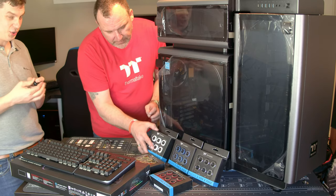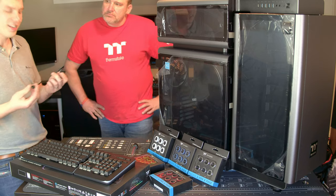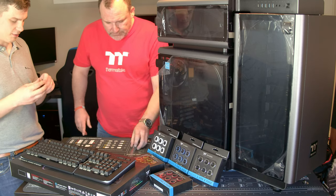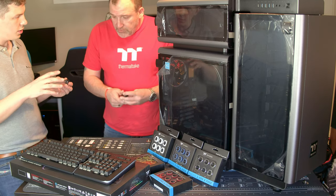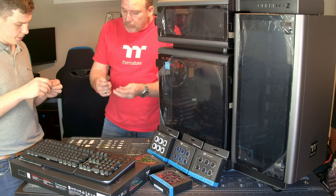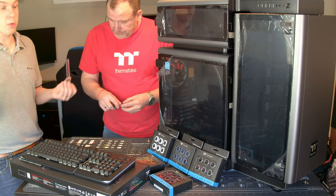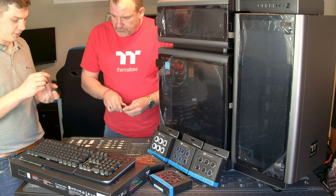I've played around with dodgy Chinese fittings in the past, and you can always tell from the machining, it's the biggest giveaway, but with these the threads are nice and smooth. Exceptional quality. I think anybody could really do a hardline build. Do you do these in 90 degrees? You have the 90 degree adapters, which then thread on, they're all G 1/4 thread. So you could technically do a build with this without any bends? Yep, you can't get much more simple than that. I like that.